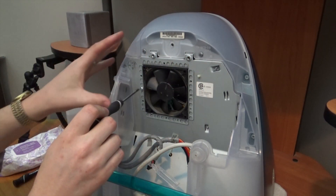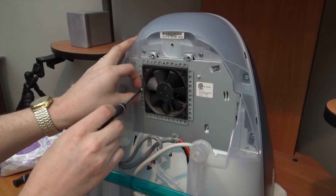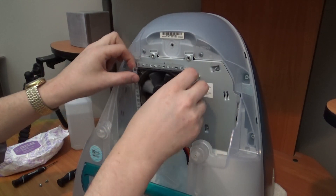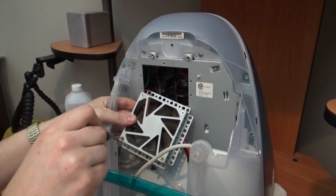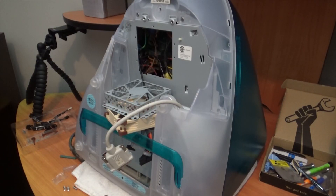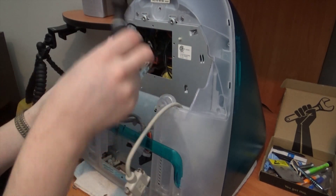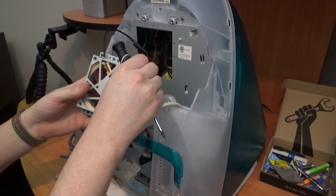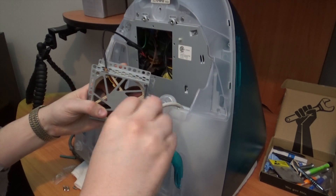Next we're removing the old fan. It's attached to the bottom of the CRT by two screws. Take those screws out and the fan, its stand, and housing — that little perforated metal bracket — will all slide out. Unscrew the fan from the housing, cut the wires, and get ready to install the new fan. I did have to solder the leads of the new Noctua fan on since there was no connector I could use. This fan will probably outlast anything else in the computer and it's a noticeable improvement as far as sound radiating outside the case.